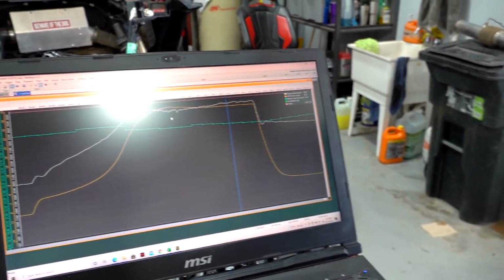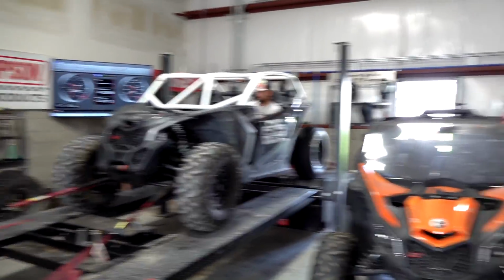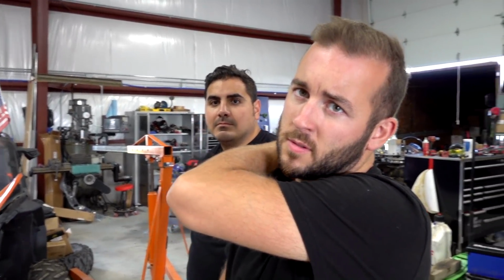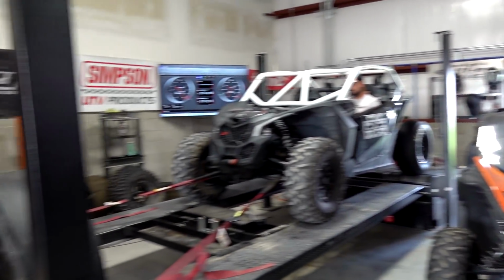Yeah, let's put a couple pounds in it, crack pressure, and run it again, see what happens. I like that. We pump some more boost into it, make another pull, see what she does. How much more crack pressure? We're about 3 more pounds. So we're not going too crazy, but you know.